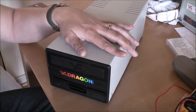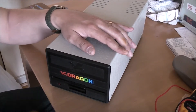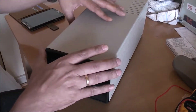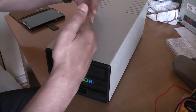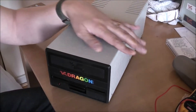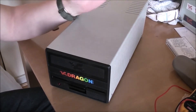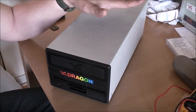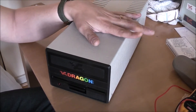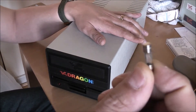So I messed about with it for a while, testing voltages and fiddling about with it, and I actually got it to work. At the time I had the internal drive out and set on its side, and I got it to work — it was reading and writing to disc — and then all of a sudden it just died completely dead. Nothing. So I went over it and I realized that it had actually popped the fuse.